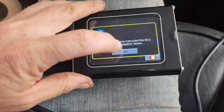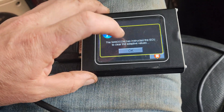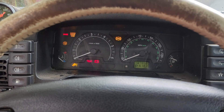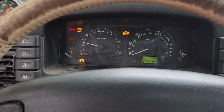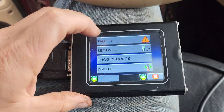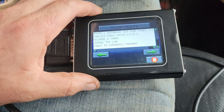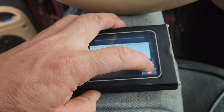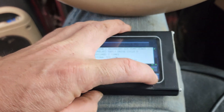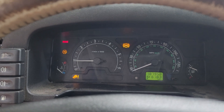With the new crank sensor installed, the next thing is to reset adaptive values. According to the RAVE manual it's something you have to do — I always do it twice just for good measure. Let's see if we get a start. Nice, she fired right up. Going back into the Nanocom, we'll clear the faults. My secondary air injection code is always there, so don't judge that. That's the only fault code we've got — no more check engine light. The other four little warning lights are a rear wheel speed sensor, which is my next project.